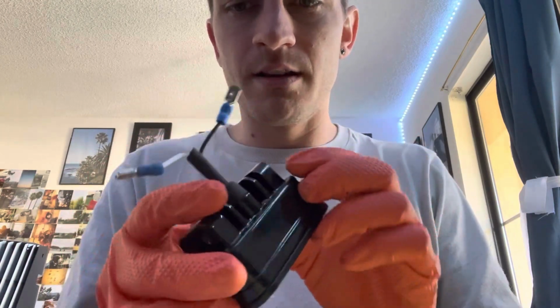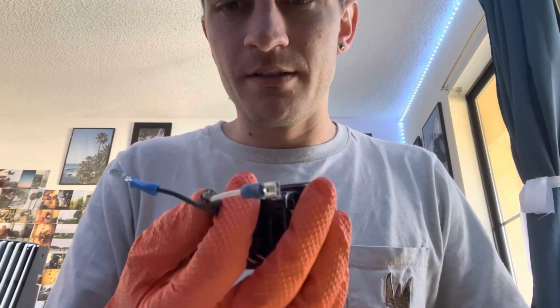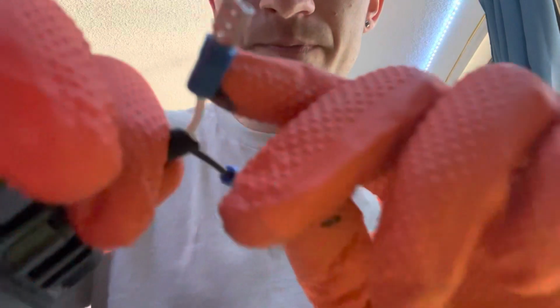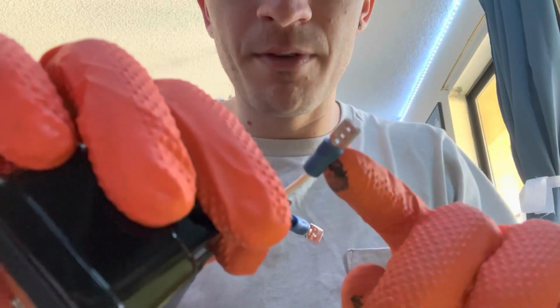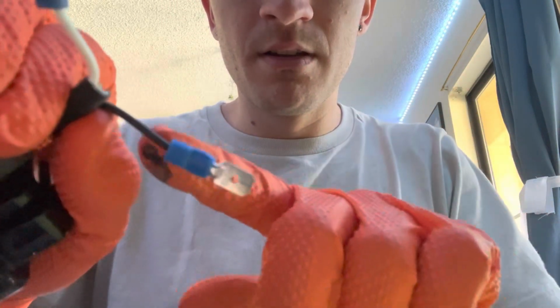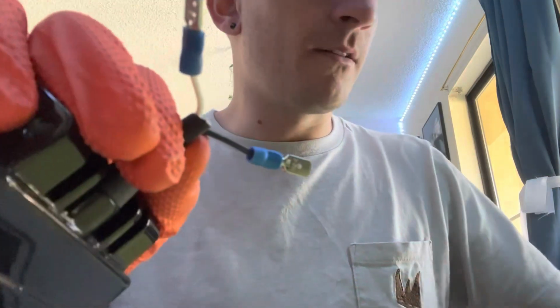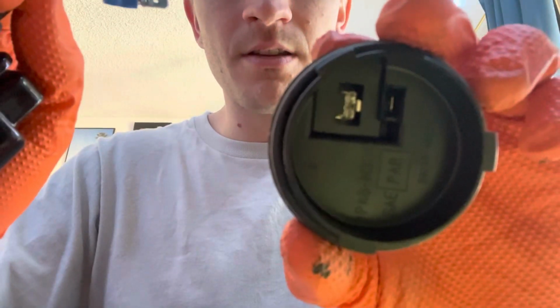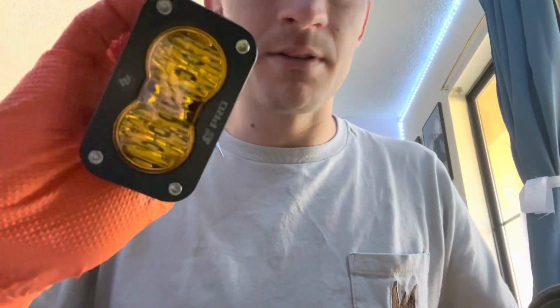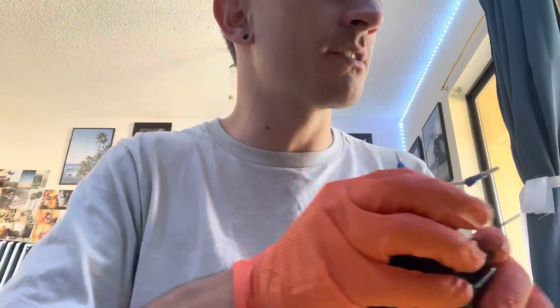I ended up making the light. I tested it on the harness. Sadly, these were reversed. Okay, well, I have a female connector here and a male connector here. This is power, gets the female, ground gets the male. Those fit into the slots on the cap, and you can use the stock harness to power this up. It'll turn on with your fog lights.